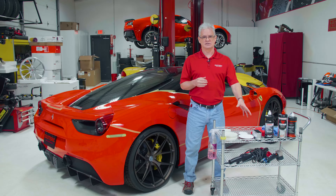After we do our compounding, we do our finish testing. We're taking our measurements and looking at it visually to make sure we're getting as much clarity with as good a finish as possible. Each area of this car may have sanding marks — we'll go into that in the next video. We may have to use a slightly different process than the area where we're just getting out basic swirls and holograms that come from the factory with their polishing process.